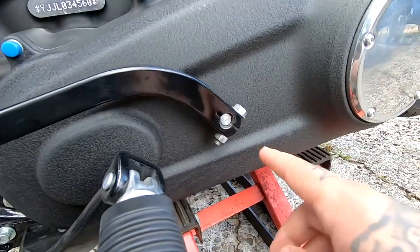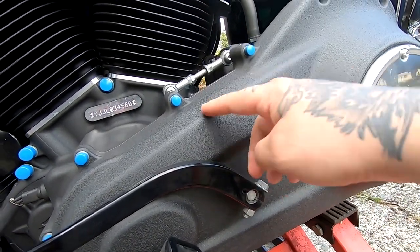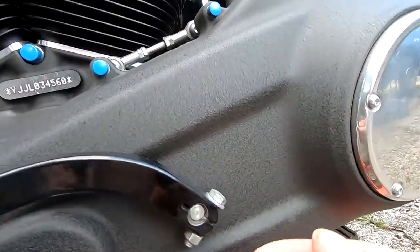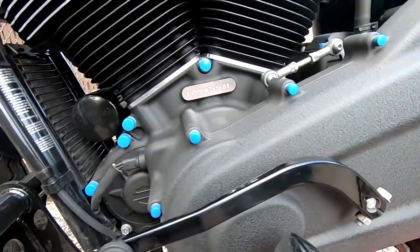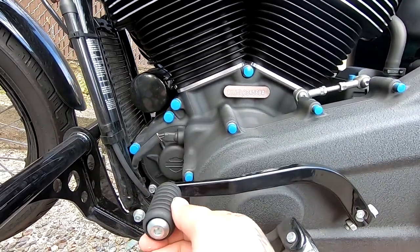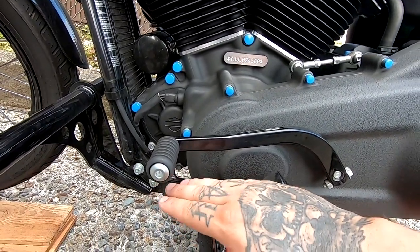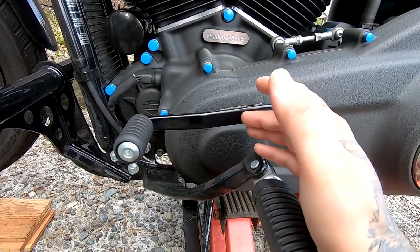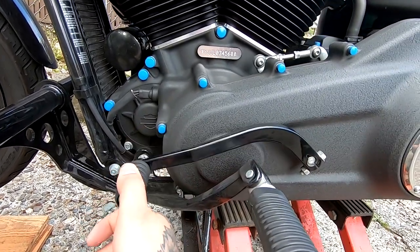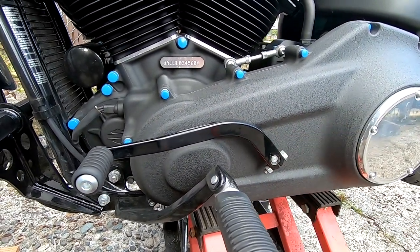It's as easy as this: take this bolt off, pull the nut out, then throw a towel over your cover and use a flat screwdriver to pry the arm off. You'll see it's got teeth on the inside — lower it one tooth down. It was sitting really high, so that movement was a real pain. Now I really like the position one notch down. It fits even with steel-toed boots with no clearance issues. I don't see why you'd take your bike in — $125 for simply moving one bolt one tooth. Swap it out and you're done.